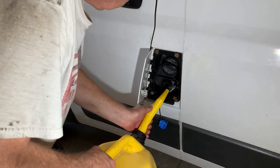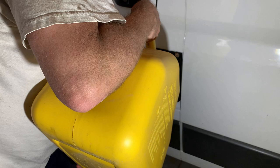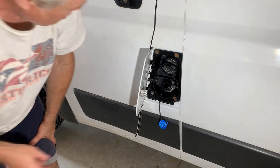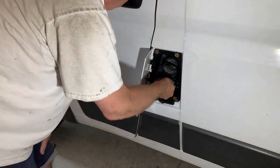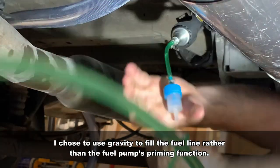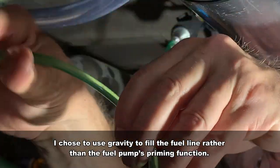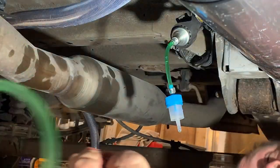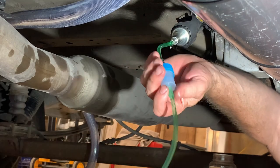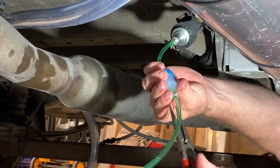The DEF opening is too small to accept a diesel fuel nozzle — I knew this going in. It just means I have to use either a funnel or a jerry can to fill the tank. Not ideal, but a necessary and welcome trade-off for enabling me to store diesel outside of the vehicle. I'll paint the cap yellow in the near future. Let's see if we can get some fuel in this line. There's fuel — definitely fuel. We got fuel in the line, diesel everywhere. I'll button up this line later; I wanted to make sure the heater works. And this is working perfectly.